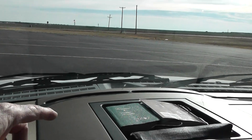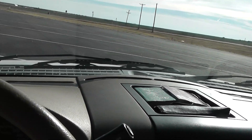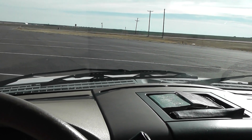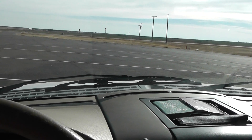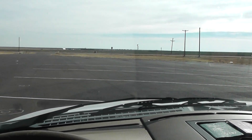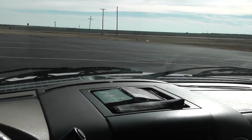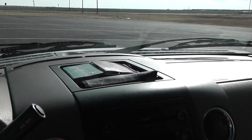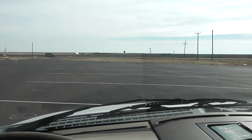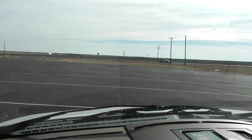If you don't believe it, just take an add-on compass and set it right here. When your lights are off, look at it and see what it's reading, and then turn your lights on. You'll see it'll go an eighth to a quarter of the way around. So it's absolutely imperative that all the electrical be off — lights, stereo, air conditioning, everything. And don't be around any electrical power lines or tall buildings. That's why where I'm at is an absolutely perfect spot for it.